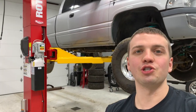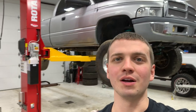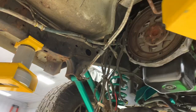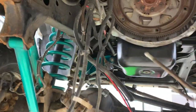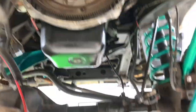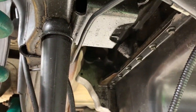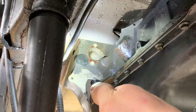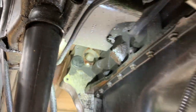It is day two here at the shop for the transmission removal. Last night the trans got out but we were all dead tired so we went home. Now we're back for prepping and reinstallation of the new trans. Removal went pretty smooth. We have a new flex plate for this. There's an access point on the side of the back cover of the engine — put a flashlight on it, you can see those two bolts that held a cover on. That cover comes off and you can get your converter bolts out.